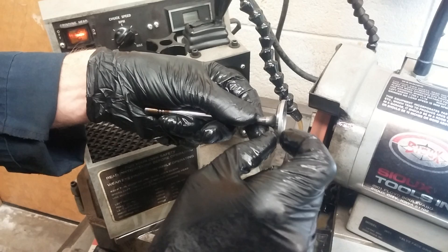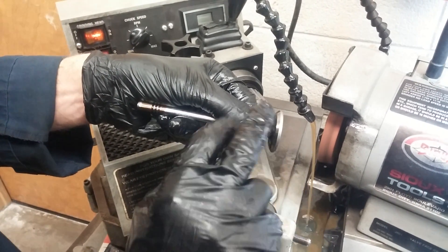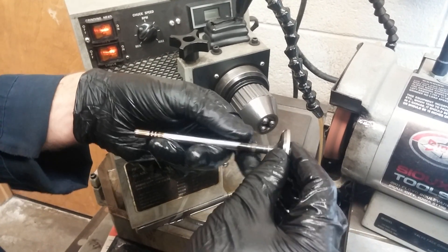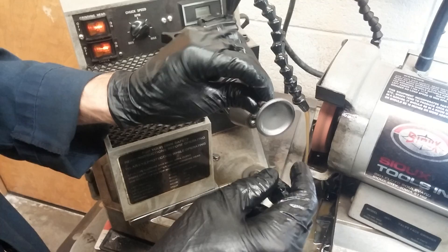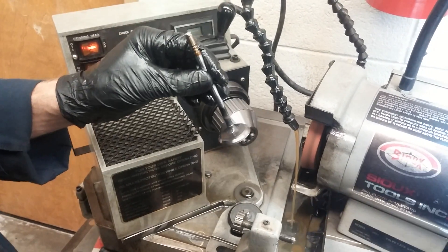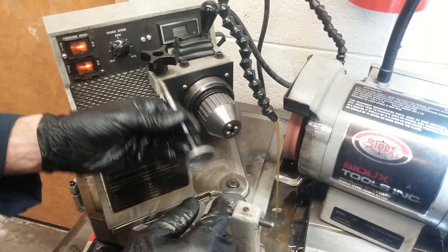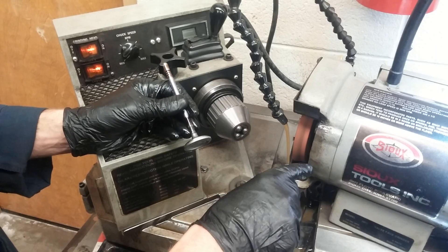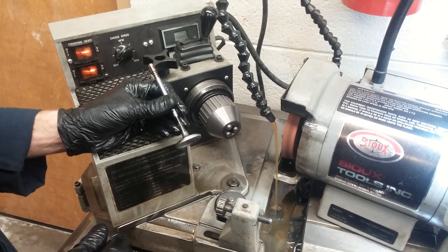After we're done, we're going to want to measure the margin — this strip right here — and make sure it's still within specification. If I grind too much off the valve, that margin gets too thin and there's a good chance the valve could burn later. That's the reason why I want to take off as little material as possible when I grind a valve. Just repeat that process: do the tips on all your valves, then the chamfers on all your valves, then the faces on all the valves at the same time to speed up the process. You should resurface the stone on every cylinder head — for about every 8 to 12 valves, you should true the stones again. That's how you grind valves.